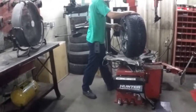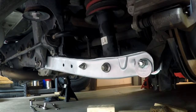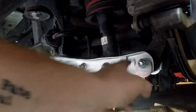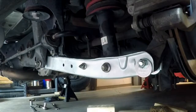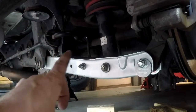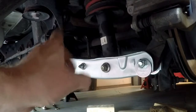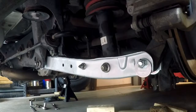Something important to note: you don't want to torque any of these down until you have the weight of the car sitting on it. I've run everything up tight — as you can see I have anti-seize on everything, you know how much of a preacher I am for never-seize. The only things I haven't put back on yet are the sway bar clamps. I'm going to wait until everything else is on the other side so when I struggle with the other side I don't have to undo it again.